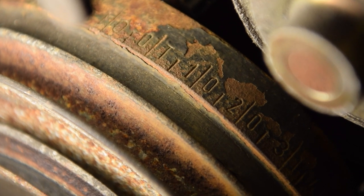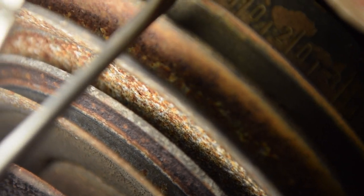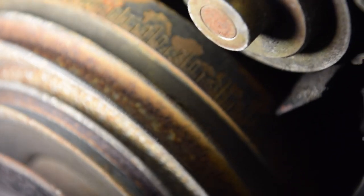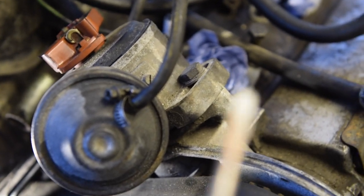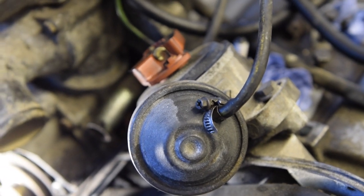It's time to remove the distributor. What I need to do is get the engine at TDC, which is very hard to see on this because it's so rusted. But just there is zero T, and I need to align that with this marker here. When that's lined up, the engine is at TDC — top dead center. Then I can just unscrew and pull the distributor out. The distributor's there — from quick inspection, it looks like I just undo that bolt and it just pulls out. Let's try and do that now.